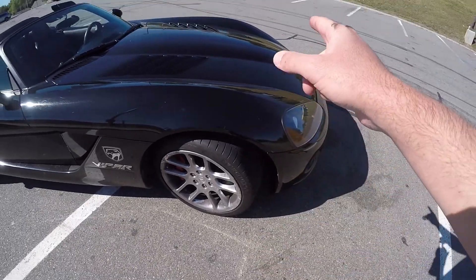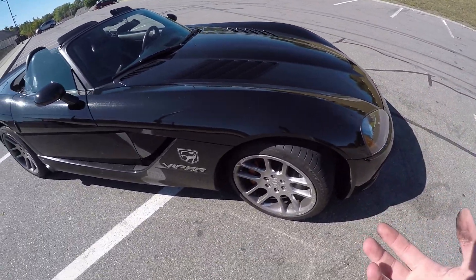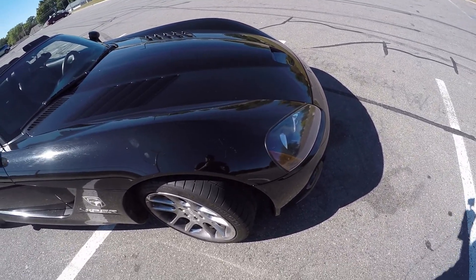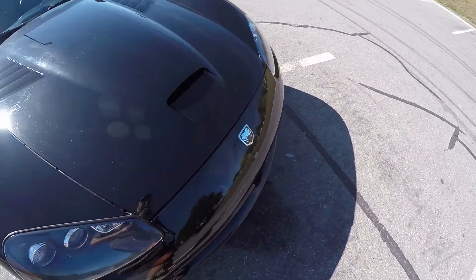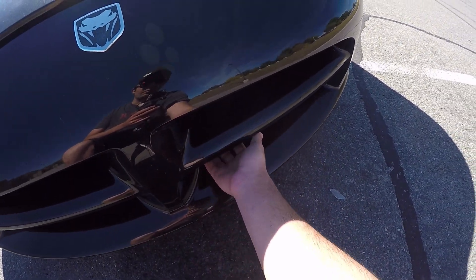Now when you're doing front brakes on a car, you never do only one side, so I am going to replace the brakes on both sides in the front — both pads and rotors. But other than that, the car is in very good mechanical shape. There's about 34,500 miles on it and the whole car is pretty much original. So, popping the hood — which is done through the front bumper if you didn't know on Vipers — pro tip: if you do this without the keys, you will set off the car alarm, so please don't break into people's Vipers.